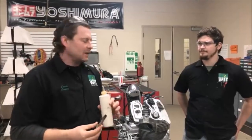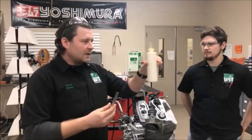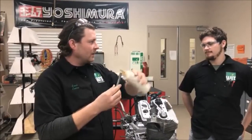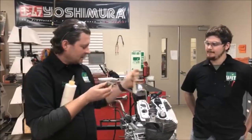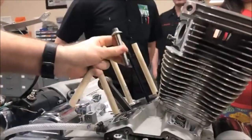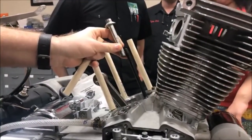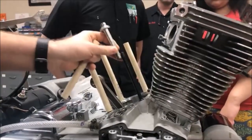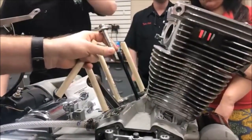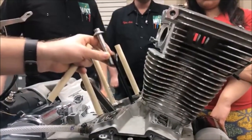I talk about this all the time. It drives some people crazy and some people love it. About every mechanic should know this. Oil will not compress, right? Yep. If I fill this up with oil and I'm not paying attention, I put a lot of oil in here. What's going to happen is the stud, let's go ahead and come around the side here. So that stud, if there's oil in there, it's going to get to a point. You got to think, this has to go through the whole head. So we're only going to grab onto, say, that many threads. If I have oil in there to where it could hydraulically lock, I'm going to have a bad problem. You have to put a lot of oil in there, but apparently that's what somebody did. Okay, wasn't paying attention. This is not good. You just want to lube that up that way.